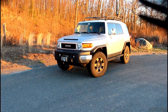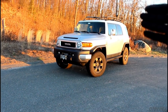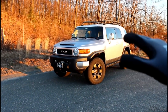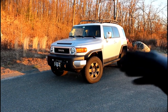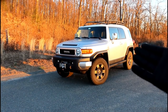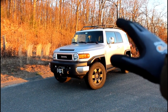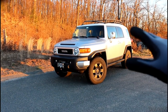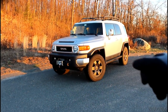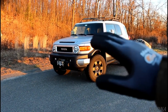The first thing I like to do when getting my vehicle ready to battle salt and whatever else winter may throw at it is give the vehicle a real good wash and a heavy coat of wax. I'll also fill in any paint chips and whatever else I may not have gotten to yet. We need to seal the base metal underneath the paint against the salt and corrosion, so the touch-up paint will put a nice physical paint barrier on top of the metal.